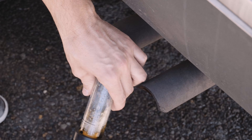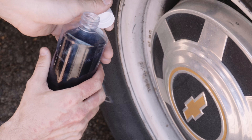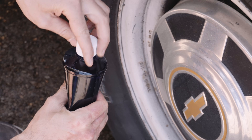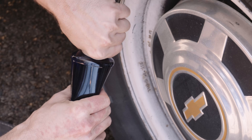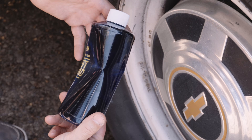If you work in a shop with exhaust fumes constantly circulating, consider squeezing the excess air out of the block test fluid bottle to prevent any unwanted reaction while it's sitting, and store the fluid in a drawer or cabinet to keep it away from any fumes. Hope this helps with your diagnosing. Thank you all for watching — see you in the next one.